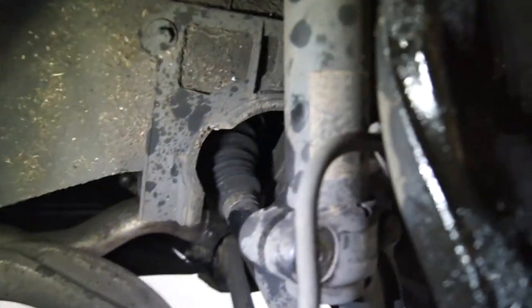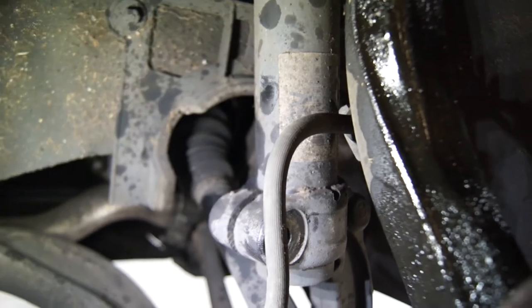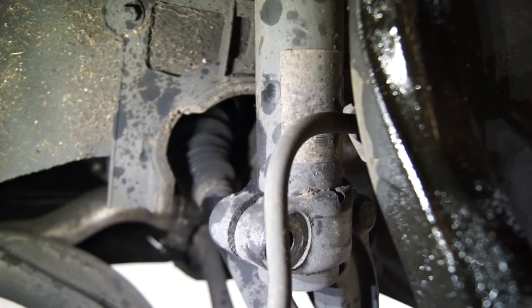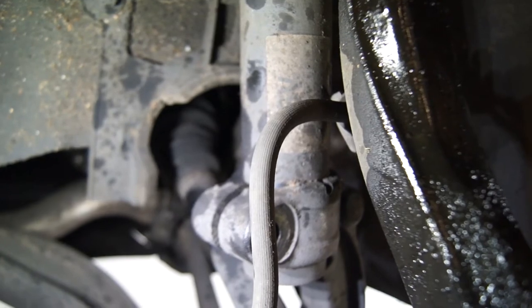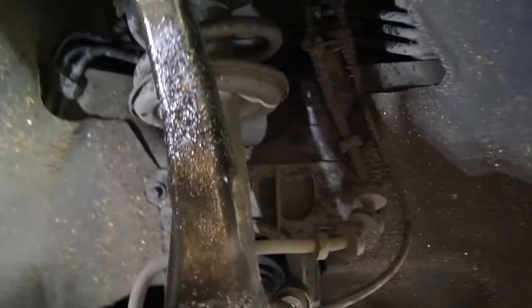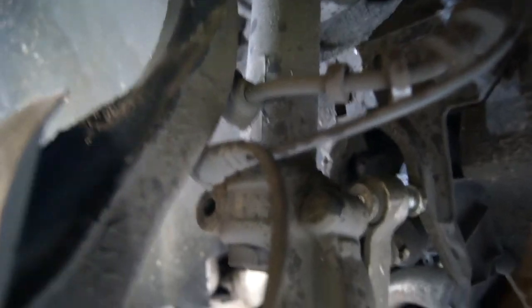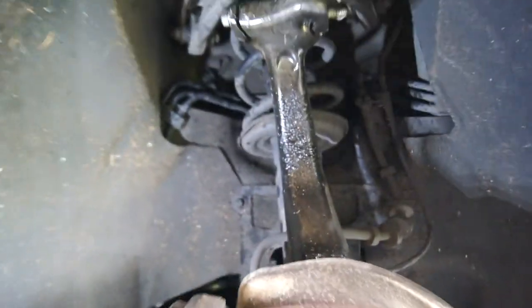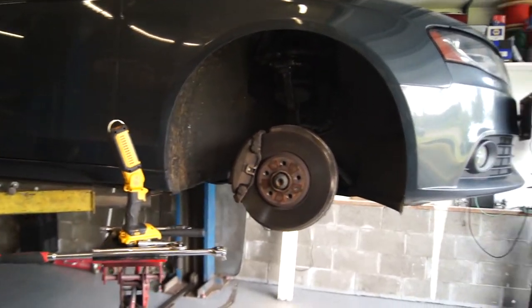The other thing is the strut mount. I wasn't sure if I was going to buy this tool or not, but there's an oval-shaped socket that has an oval-shaped stud on it with two flat edges. Basically, you stick it in there, rotate it 90 degrees, and it spreads that out without bending or scarring it. What it does is it makes the hole bigger so you can slide it up and down without problems. We're going to go in search of that tool — probably start at AutoZone.